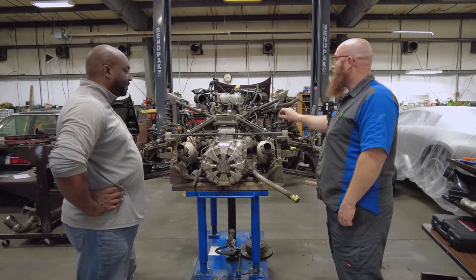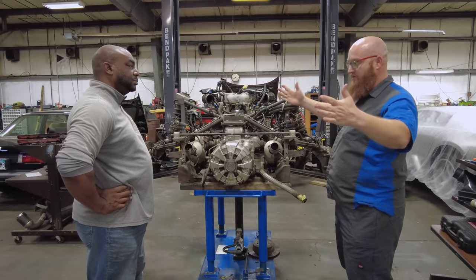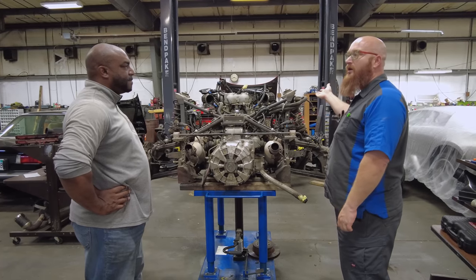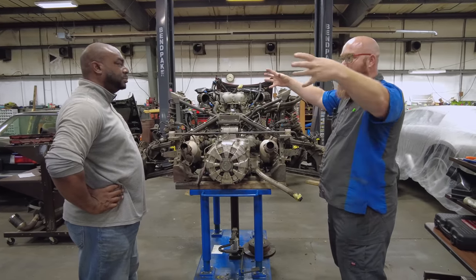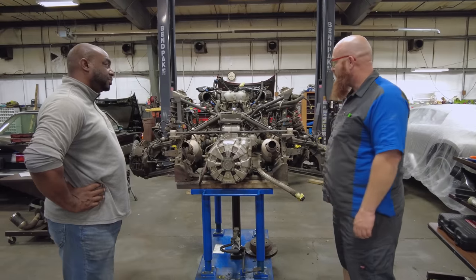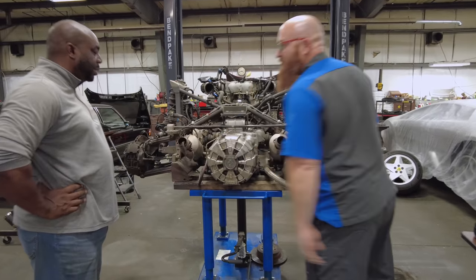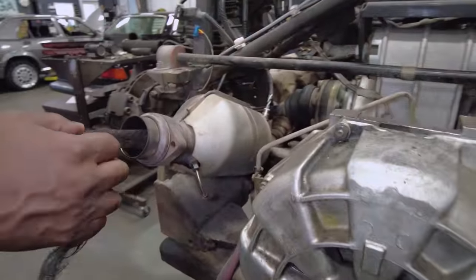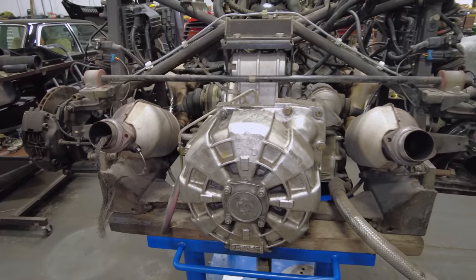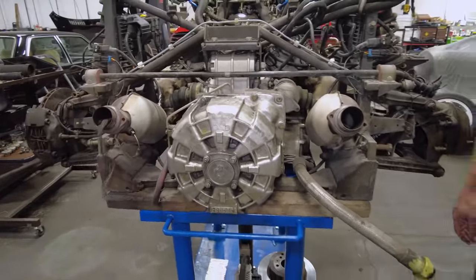The 360 actually has an access panel — you pull the seats out and reach through a panel roughly this big, and you can do the timing belt service that way. The reason this 348 doesn't have that is there's a fuel tank right behind you, so you physically can't get to the timing belts. On the 360s there's a left and right tank, and the gap in the middle is open so you can reach the front of the motor. Danielson is having fun with this — his list is already five pages long. And the catalytic converters are shot, so we're exploring stock versus aftermarket options.